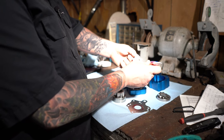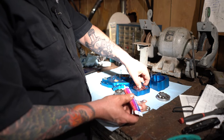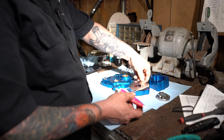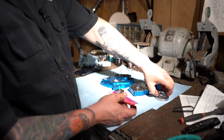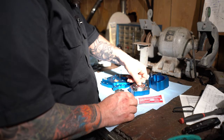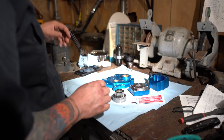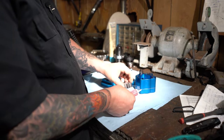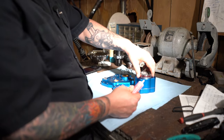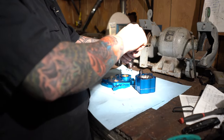If you end up using all of it, you can buy more of this stuff. It's relatively cheap. No shame in ever using too much. You can get to walk around there, make sure it's all lubed up real well. Put your plate back on here. And this outer one here, I'm gonna rotate this around so all the flats in here line up. It'll make installation out of the crankshaft 100 times easier. I'm gonna slide this in here and put some down in there, even around the outside of this oil pump. Slide that down in there, give her a spin, cover this sucker, and inside too.